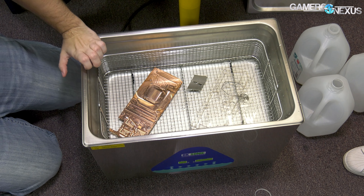I stole this storage container and hopefully Steve is okay with me pouring a bunch of vinegar into it — but he can't stop me right now. This was about a dollar's worth of vinegar. We're going to flip the block this way so the darkened side is up. People will complain that debris will settle in the block rather than float off, but if I flip it the other way there'll be bubbles underneath it. So we're going to leave it like this and let it sit overnight.